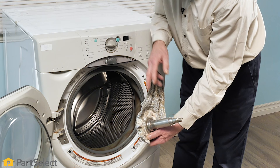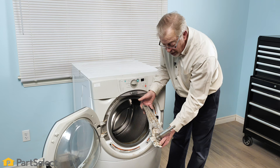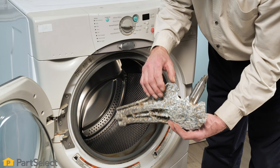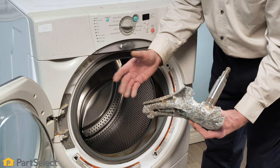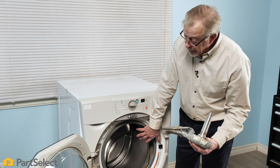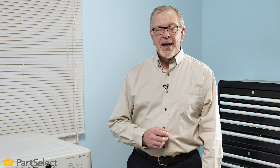This is an example of a tub support — you can see the shaft at the back where the two bearings would sit, and there are typically three legs that attach to the very back of the inner basket. You can see what the detergent and minerals in the water have done to that alloy — basically destroyed it and allowed it to fracture and break. If this washer was allowed to reach full spin speed, it could cause serious damage to the rest of the washer or personal injury. If you have this condition, contact a reputable service technician to verify the problem and have it replaced, or replace your washer.